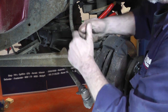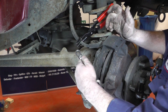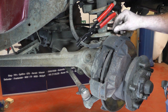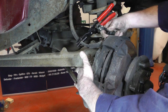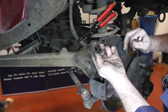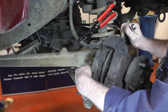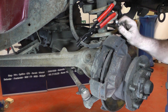This one is still steel so it has come undone okay, so we'll work that backwards and forwards. Take the brake pipe end off, and then there's a bracket that holds the flexi to the top of the stub - 17mm socket, take the nut out there, and then we can move the brake pipe out of the way. There are two bolts on the back of the brake caliper with double hex nut heads, so you do need to use a good quality socket on those because they get tight and corrode quite a lot. I would advise when you put the new caliper on, fit two new bolts as well.